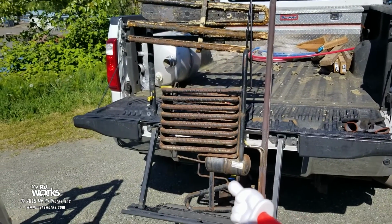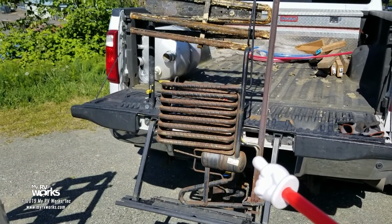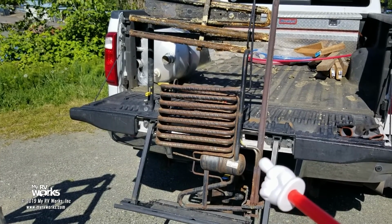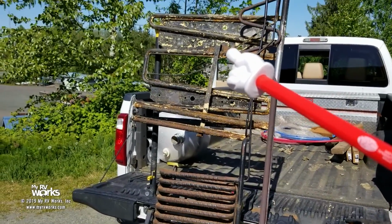Water and ammonia, inner tube, go down through here. Water seeks its own level, so that's always full of water, right? We turn on the refrigerator. The correct BTU right here causes the water to boil. Ammonia vaporizes out of the water. Remember we talked about that? There's a transition right here. This goes into the rectifier.